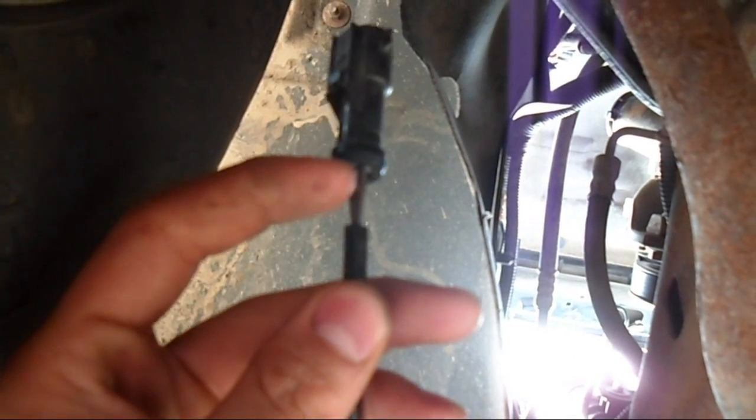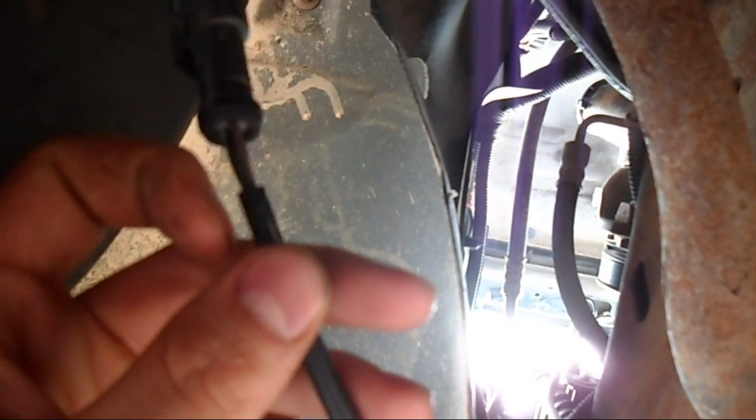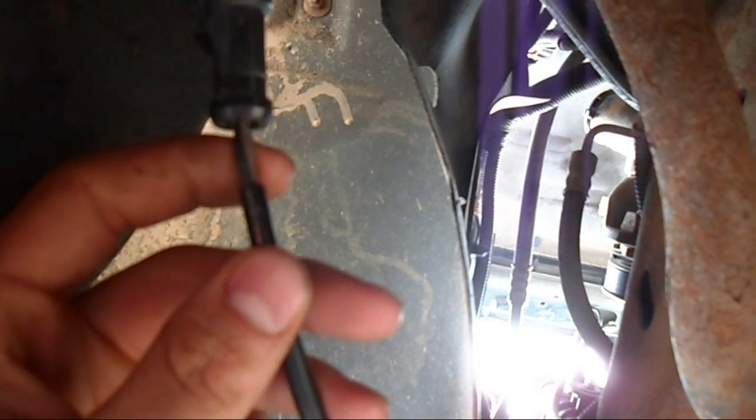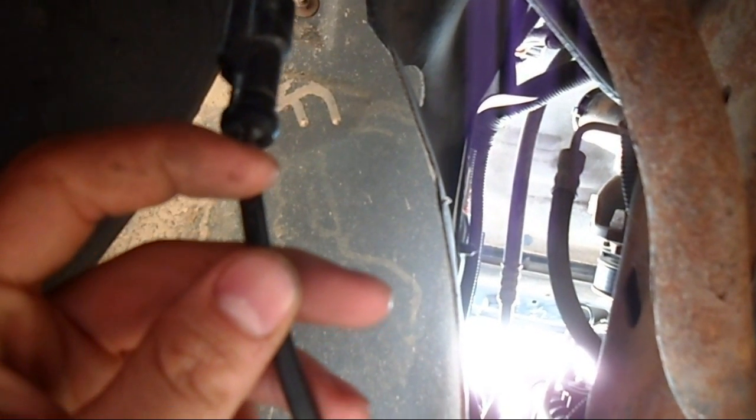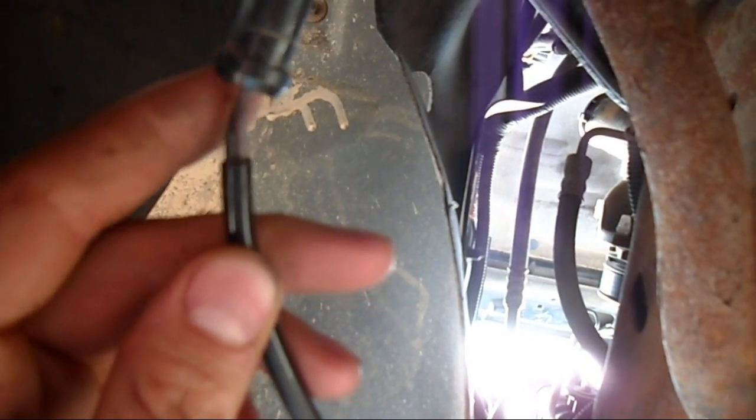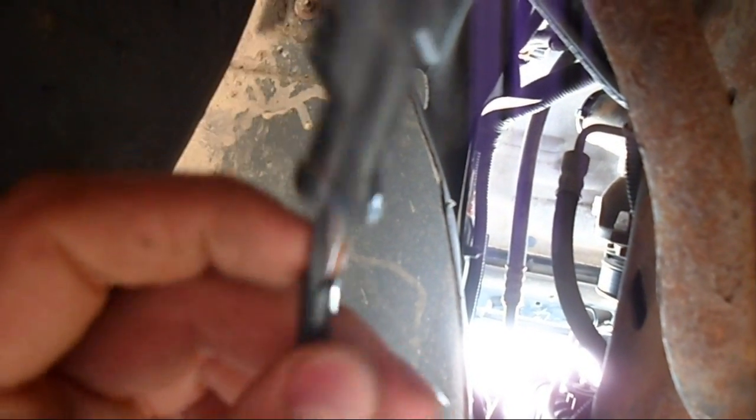What I'm going to do is just cut one of these wires, hook that to the normally closed contact on the relay, so when you break one of these, fault code — ABS doesn't work. And then if you want your ABS to work again after you've thrown the switch, you just shut the switch off, make these wires conductive again, and then shut your vehicle off, turn it back on, it'll reset the fault code, and you're good to go.